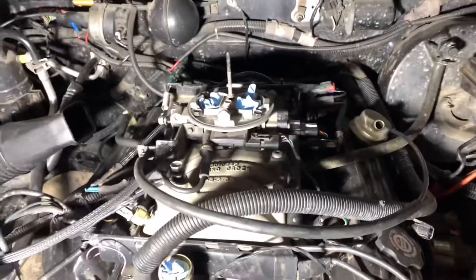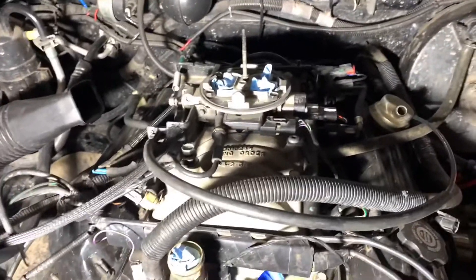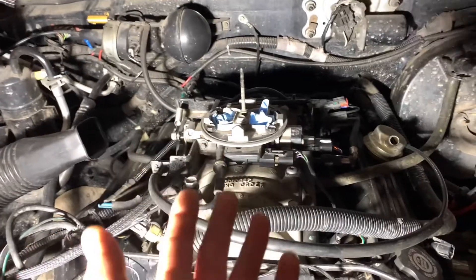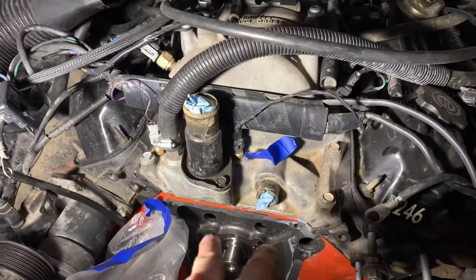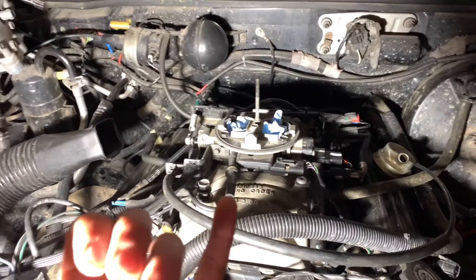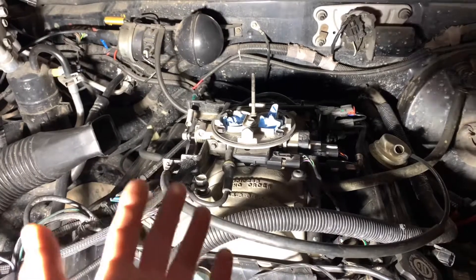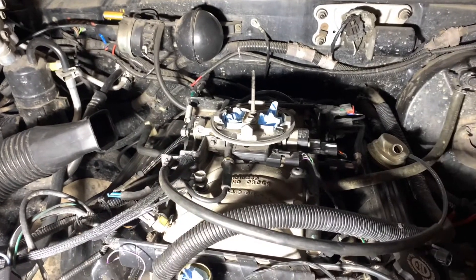That's pretty much the whole oil system. Think about it logically — if you're losing oil pressure, obviously check the sending unit first. If you actually have low oil pressure, oil is leaking out of the system somewhere. For a freshly rebuilt block, the leak could be from any of the oil galley plugs or high clearances on main and rod bearings. If you have a 300,000-mile motor with low oil pressure, try 10W-40 — that'll probably fix it since the main bearings are just a little worn.